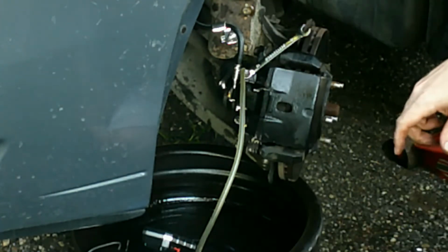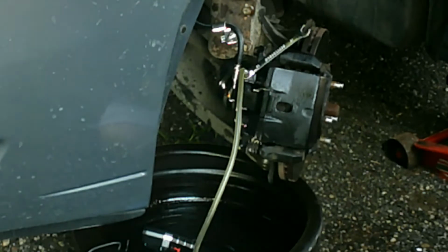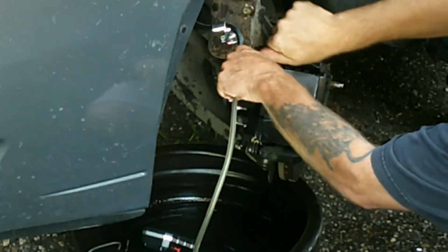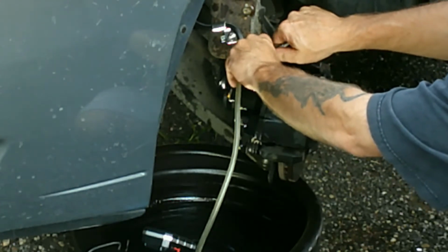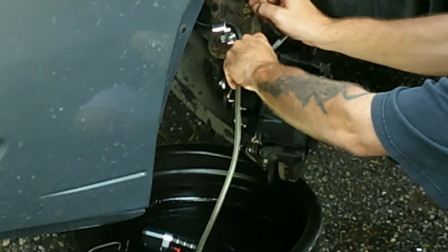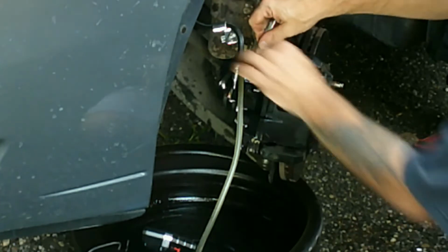Pump it up. Is everything solid? I don't think I need to bleed. It's just solid on the first pump. Start it. Car's solid, right? Oh, you put your cap on? Okay. Holding it. I think I got some air there. Yeah, definitely. Alright, go ahead and let's do it again. Pump it, pump it, pump it, hold it. You good? It feels like it.